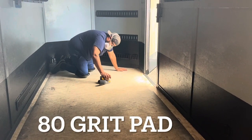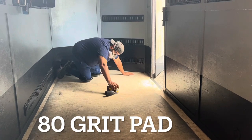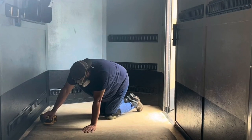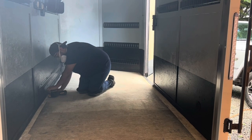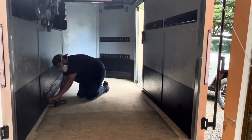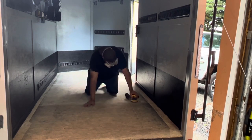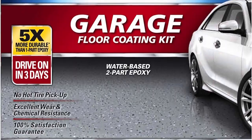I've seen lots of people do this project with big floor sanders, but I got away with the little hand sander just fine. This is simply a 6x12 trailer, so no need to get crazy — it did a great job knocking down all the burrs and rough spots. You can see I'm going over the edge, getting some overspray of the Herculiner. Don't need to make this surgical grade — just basically knocking down the rough spots and getting it ready for the two-part epoxy shield.